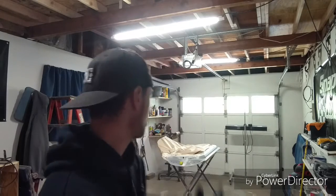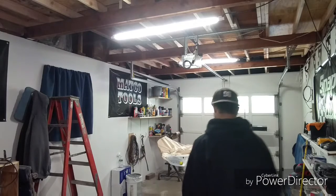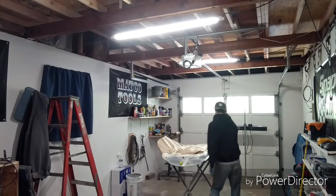What I'm going to do is just do one door at a time so that I can keep my quality control. So I'm going to try this door and see how today goes. And as long as today goes well, I'm going to keep on spraying and basically put more content out there for you guys. So I'm going to go ahead and tack rag this. I'm going to mix up my paint. It's already in the cup, ready to go. And put some paint on here.